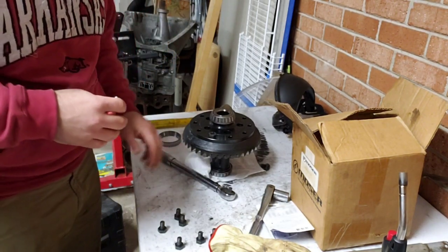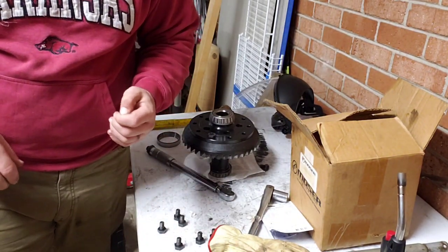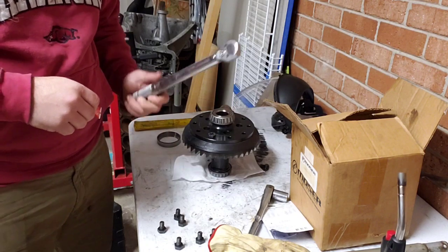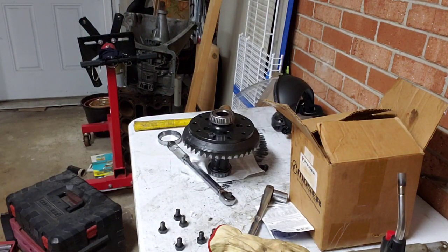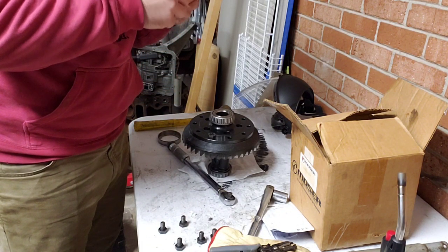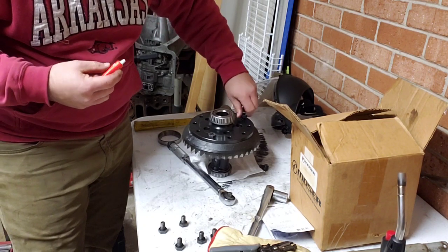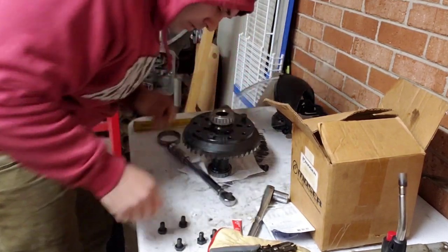All right, we're at the point where I need to torque these ring gear bolts. Got some Loctite, and I just looked up, they get torqued to 80 foot-pounds. We're gonna get close. I don't know if I'm gonna get them quite to 80, but we'll see. That's gonna be kind of hard to do, holding it with one hand and torquing with the other, but we'll get as close as we can. First of all, I need to get all these bolts started, and don't tell me that I put this thing on there a little crooked. There we go.